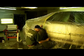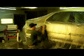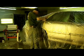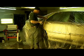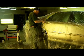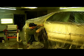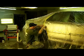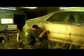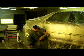The big problem with the Visqueen is, not only does paint not stick to it, tape doesn't like to stick to it either. Duct tape will stick to it, but duct tape isn't too paint friendly. Paint doesn't like to stick to that either. Whereas, I'm sorry, the tape will actually stick real well to this plastic. Last thing you want is for your plastic to not be tight, because the air from your gun can blow it loose if you don't have it taped tight.